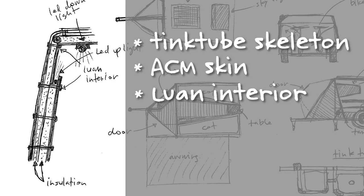I'm not going to try to do a lot of bends since this is my first camper build — I kind of want to ease into it. You have the right idea. Keep focused on that overall external integrity. Consider at least the corners and the top to have a through-bolt so a nut and bolt really holds everything together and makes sure that exterior skeleton is as solid as it can be. That's a great suggestion — I'll definitely incorporate that.